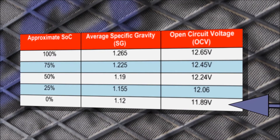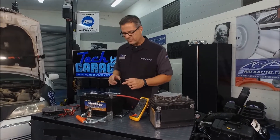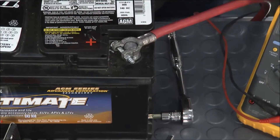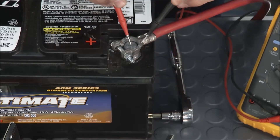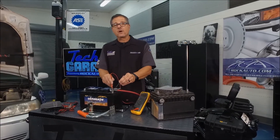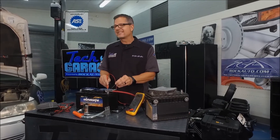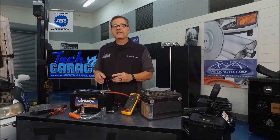Here's another tech tip for you. You can actually check voltage drop. You can go right across the two top terminals, across the battery and across the cable. Then have somebody crank up the car, and when they're cranking it up, look down at the meter. You don't want anything more than five tenths of a volt drop, or you've got a loose connection that you need to track down.